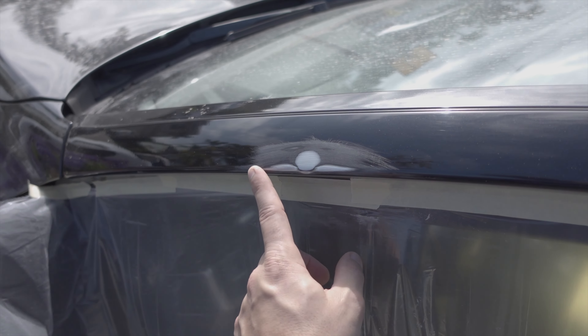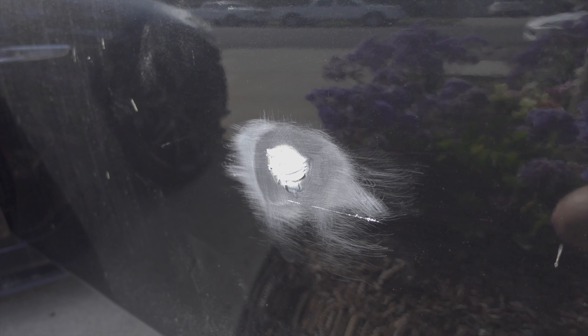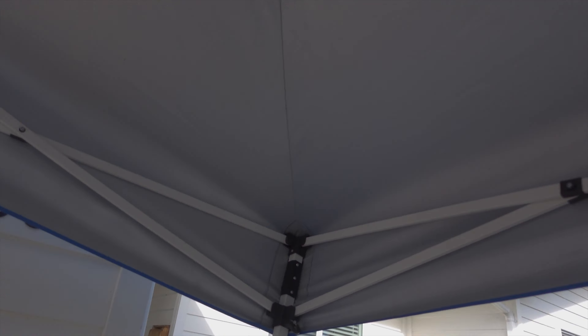I'll probably get a little bit of primer on the A-pillar spot tonight because it's exposed to bare metal. Regarding the last dent near the fuel door — similar to that one — I did one layer and it was almost good enough, but there was a tiny little divot still in there, so I added a little more and we're going to sand that down as soon as it dries. I'd say we're pretty much wrapped up here. I'll give the bondo about 15-20 minutes to dry, go back over the fresh spots with the aggressive grit, level everything out, then do 400 grit and 1000 grit, get primer on the A-pillar, and we should be able to call the F10 ready for wrap after today.